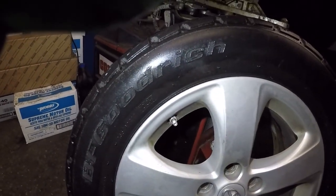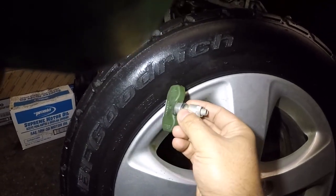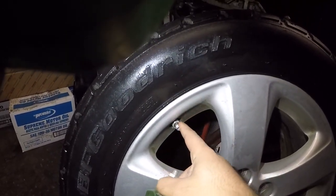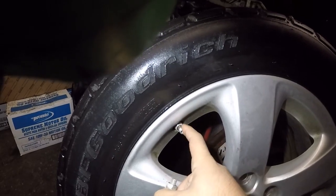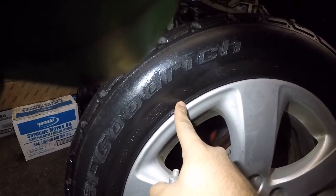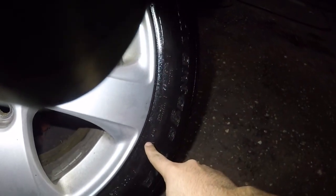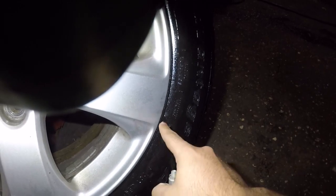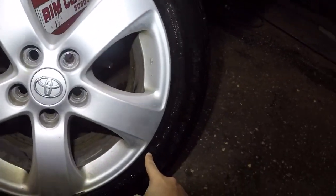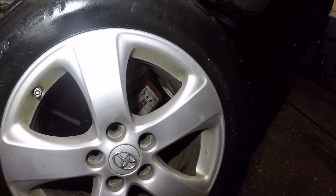So you do want to dismount this tire properly. If you have a metal valve stem, you pretty much have a sensor inside that looks like that. Even plastic ones — like GM and Chryslers — a lot of cars put a plastic valve but it has a sensor on the opposite side. Some cars like Lincolns have a strap around the tire with a sensor inside the strap.